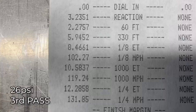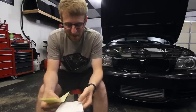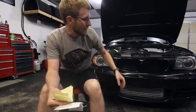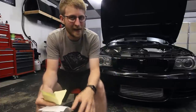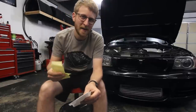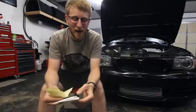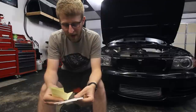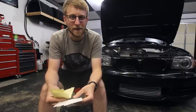Now for this pass, I decided, again, no more two-step, but I needed a limiter. So me being that guy, I decided, oh, my factory rev limiter will work fine. Let's do a 7 grand launch. So I revved her up to 7,000 RPMs, and this time I tried slipping the clutch manually. I didn't use the push button switch on my launch thing. I slipped it nice and slow, and I ended up burning through the tires in first gear. I quick put it in second, and it just shot the RPMs way down because of the tire spin in first gear and bogged that 1-2 shift. I could tell I wasn't able to bang gears as I should.